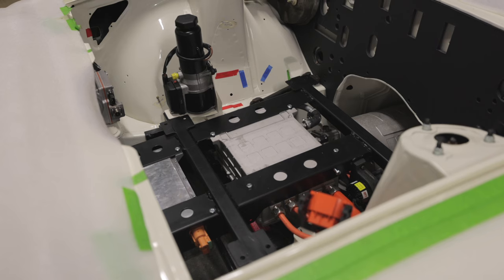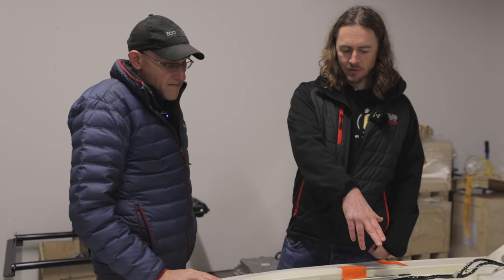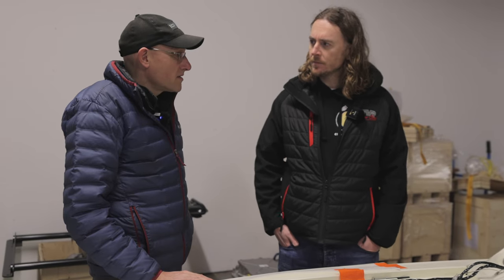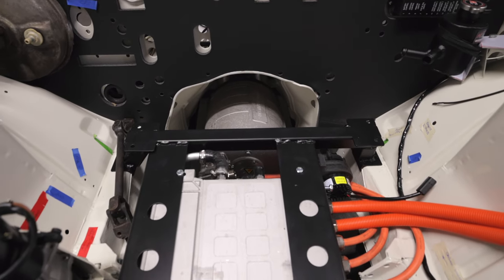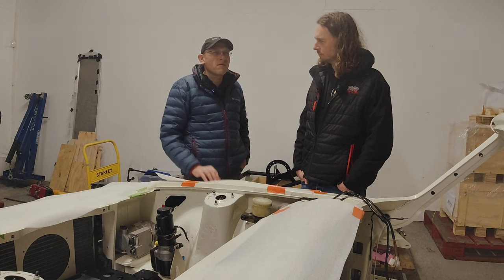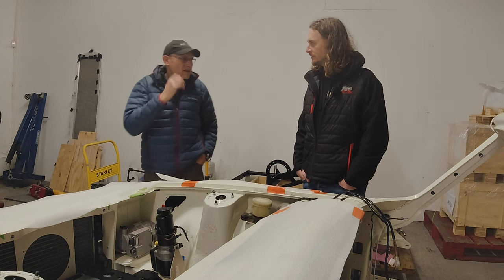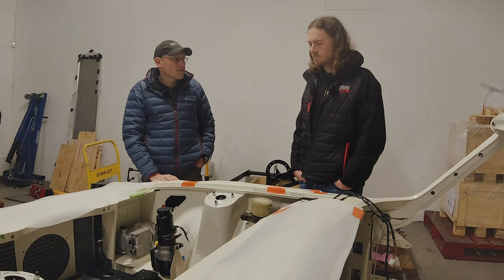It's the same 120 kilowatt motor that we use in most of our conversions, although we've just updated that to 150 kilowatt. We're probably on 25 conversions with that motor so far, and reliability has been perfect. The 150 kilowatt is actually the same motor with rare earth magnets, linked up with a new inverter — it'll do a peak of about 200 kilowatt. That's what we use in Land Rovers. Stick that through a 2.9 to 3 to 1 reduction box and you get 900 Newton metres into the transfer case, and you get pretty quick Land Rovers.